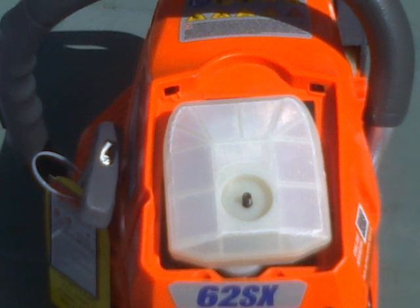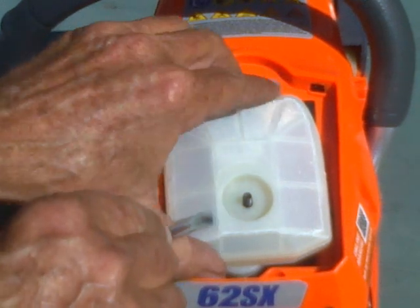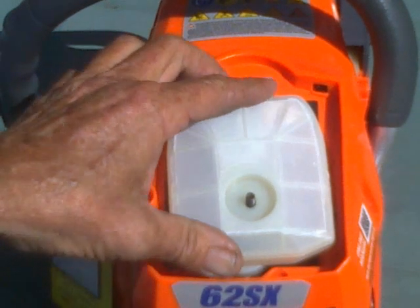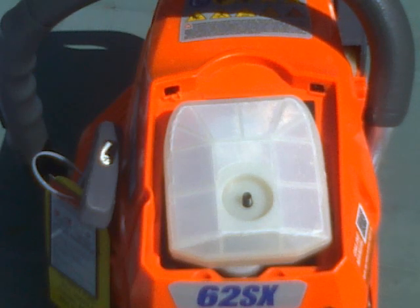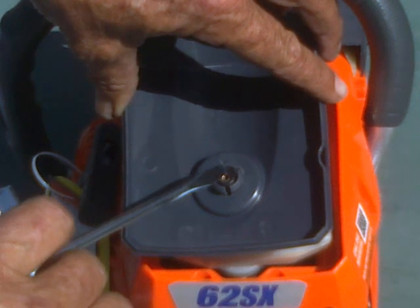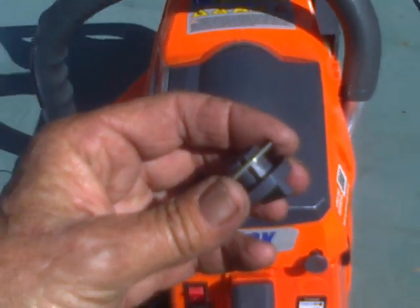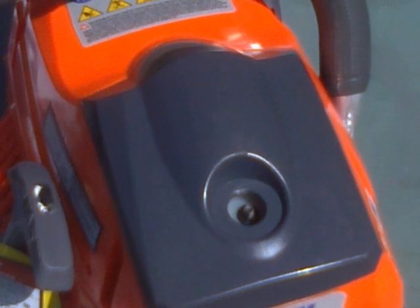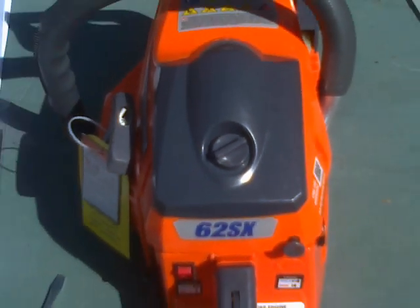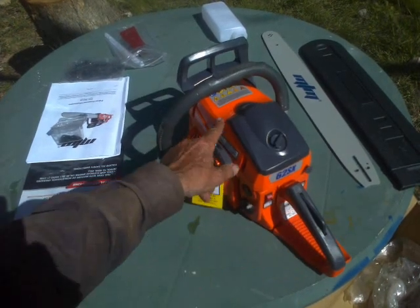By the magic of the internoodle, it has been brought to my son's attention that an O-ring in here can prevent sawdust from getting down that little hole there, around that stud, and thereby save you from getting chainsaw dust inside the air filter. So we'll do that by the addition of that little O-ring there, which sits in place thusly, thus providing a backup for that Teflon washer, which holds the air cleaner in place and seals its cover on. Okay, so that worked, and that cover actually fits all the way along.